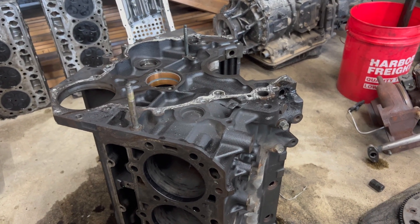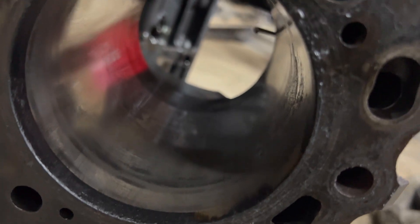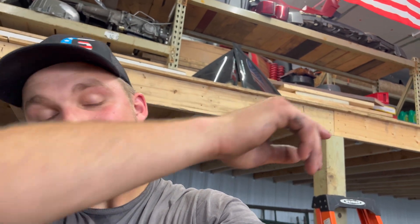I tilted the motor back up to look inside the cylinders. This thing sat with water in it — you can tell by the discoloration in the cylinder walls. The water corroded up the cylinder, which explains why the walls and piston skirts look like crap. If it sat open with water, that water probably got into the lifters too, which explains their condition. Don't let good motors sit outside, and if they have bad head gaskets, drain the coolant and oil so there's no chance of coolant getting in the motor.